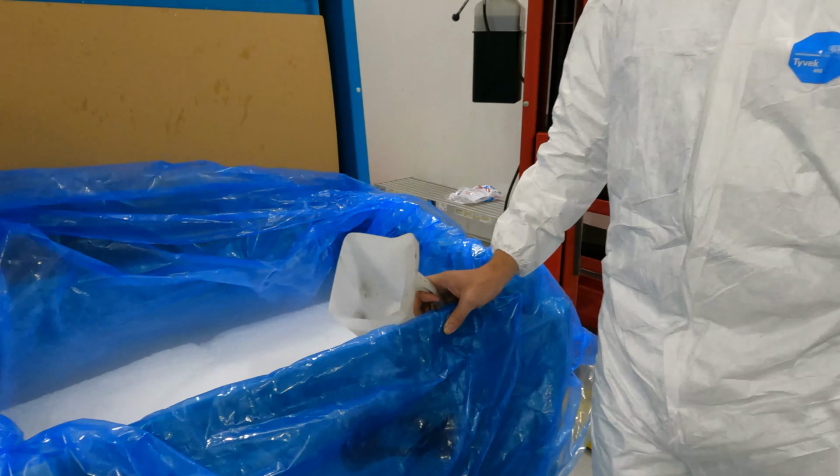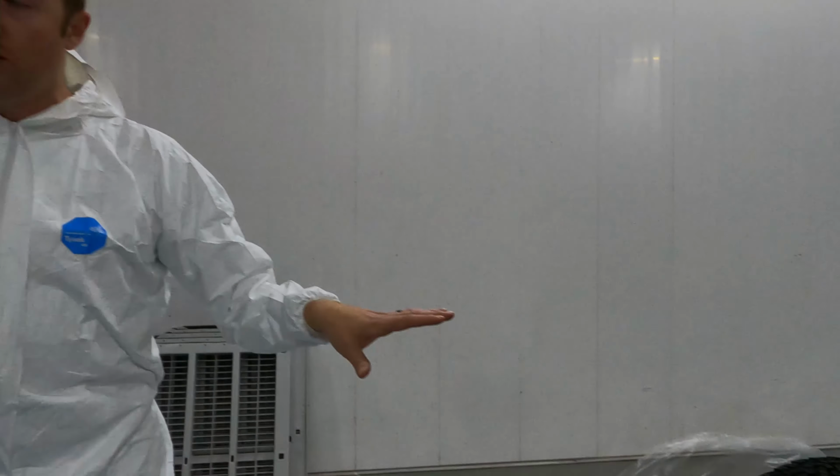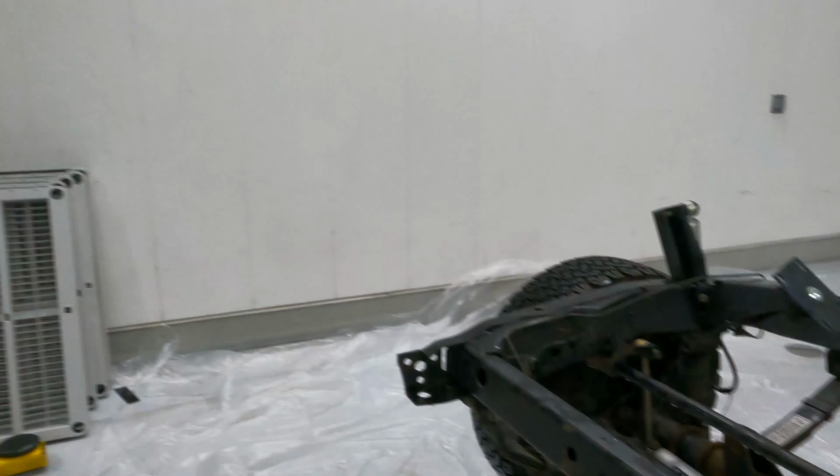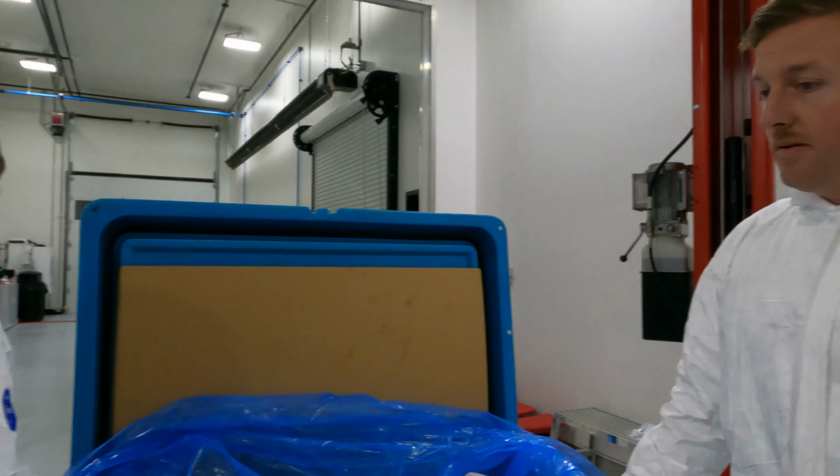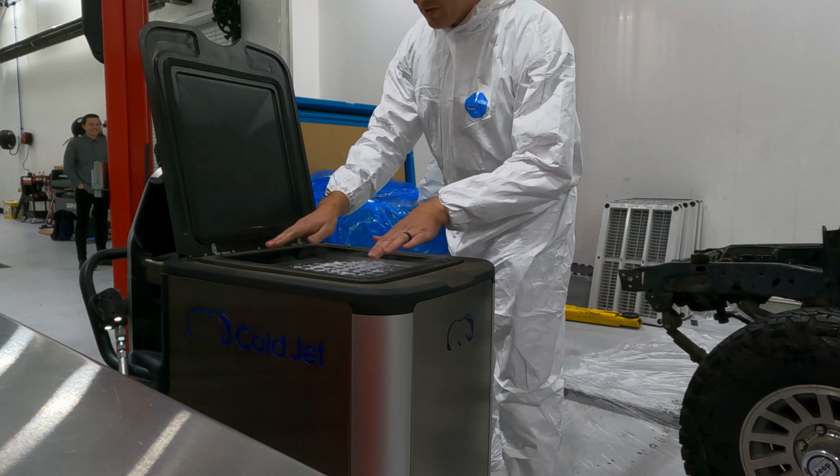It is safe to use on finished color clear paint, so some people do actually do that to their car. It might be a little excessive. Its real beauty is in preserving the medium below what you're attacking with the dry ice, without being too abrasive. Yep, it is going to abrade slightly, but not in a manner that will degrade the finish. The abrasion is in the form of the ice striking the material, freezing what is on the material, and the compressed air dropping it off the material while preserving the material as we see it. Right.